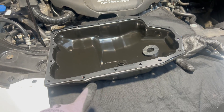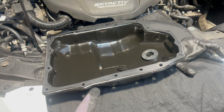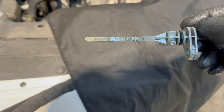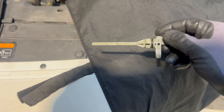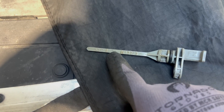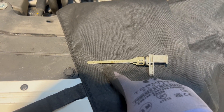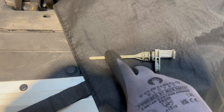The last thing I want to do is use a Helicoil set to re-thread the transmission block. Here is the dipstick — there is that 10mm bolt hole where the bolt goes. On the dipstick it says 50 Celsius, so you should check the transmission fluid level at 50 degrees Celsius, and it should be just at that notch. We're going to fill it first with around four and a half liters, heat it up, cycle the gears, then recheck, but I'd guess it will take around five liters.